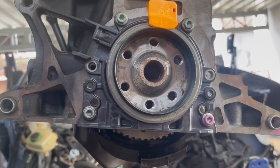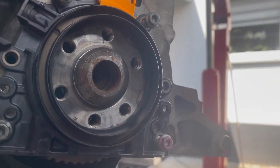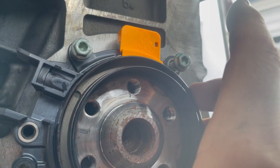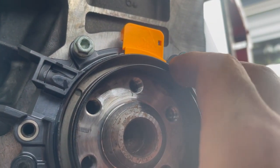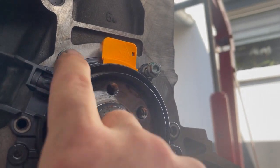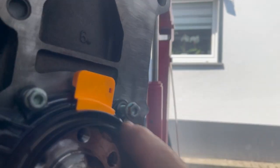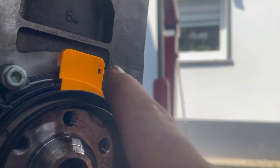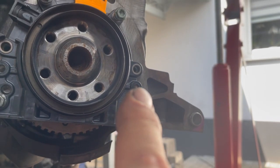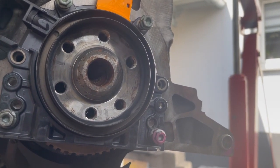What I figured out is to use the old seal ring — the old ring with the hole in it — put it on there and tap on it with a hammer, just tapping lightly all the way around. You can see how far I've already compressed it in. It's taking really, really light taps — nothing strong — just tapping around so it goes on evenly. I'm going to try to get it seated and then tighten the bolts.